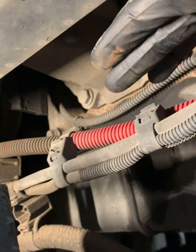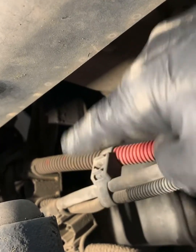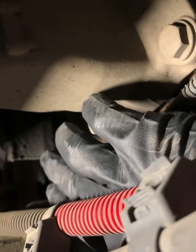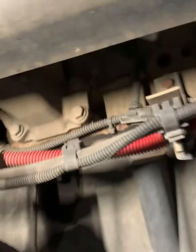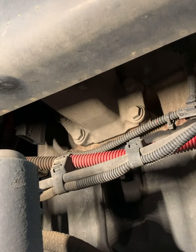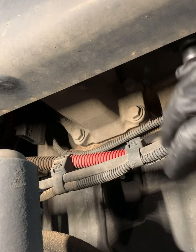We're going to undo the four bolts and remove this crankcase ventilator. You can tell this is bad when it's just pushing out oil — it's all against the oil pan here. When it's pushing oil right out of that thing, or it'll throw a code for being full and the RPMs are too low, stuff like that. Do not forget that you need a drain pan under this because you will make a mess. Sometimes it's a lot that comes out, sometimes it's a little.